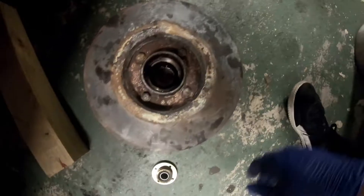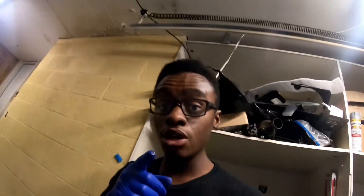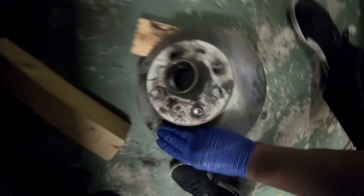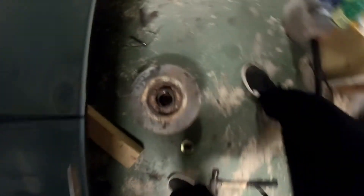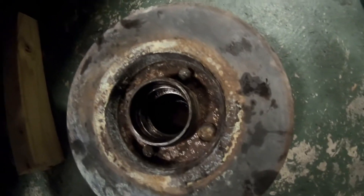The races are already punched out. If you guys saw the last video, you saw me punch out those races — and if you didn't, watch the last video. The front race goes in there and it's no longer there. I'm gonna start from this side and clean out all the old nasty grease and then we're gonna put our new races in. I kind of made a boo-boo and marked up the race seat — the area where the race is gonna sit — and it's kind of bad.